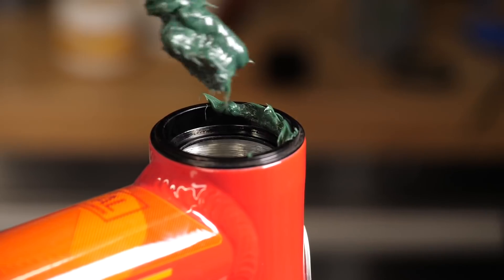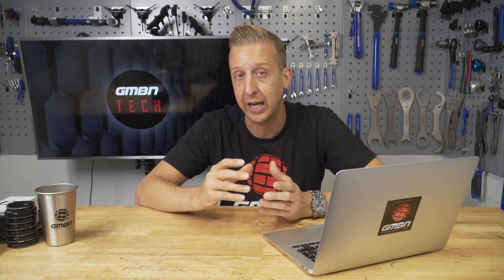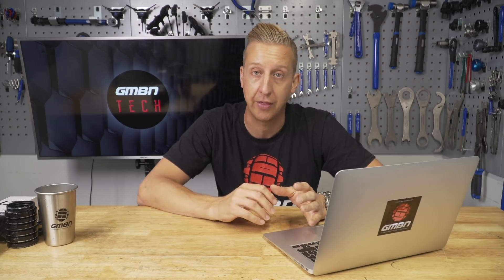For example, grease you would use in the ball bearing system or cartridge bearings — the idea is you want to minimize friction on the rolling surfaces. An assembly compound you might use on the stem clamp where a handlebar sits, especially with a carbon bar, because you want to add a bit of friction where the bar is clamped. That way you don't have to overdo the torque on the clamp bolts, because with a carbon bar you can actually crush it. So if it is an assembly compound, use it only in certain places like holding a seatpost or clamping a bar. Anywhere else with moving parts, stick to regular grease — and if it's carbon-friendly you can still use that, no problem.